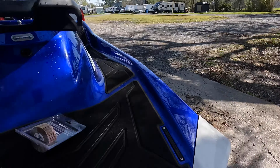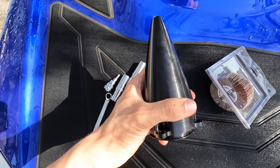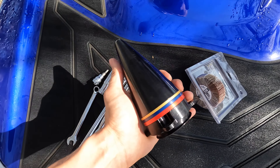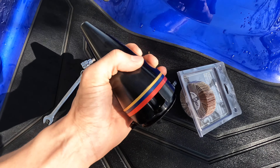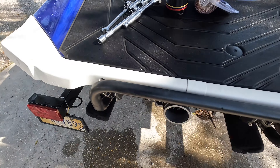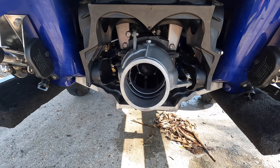That was 86 miles an hour at over 8,300 RPMs — higher RPMs than what I wanted. We're definitely going to get some speed increase with this pump cone and a little bit of an RPM loss, which in this case is a good thing. This is our Lucky 13 pump cone — it is adjustable. We've got three different spacers in here; I'm going to install this with the red and the gold spacer for now, that way he's got some spacers to take out in the heat of summer to get the RPMs back up, and spacers to add in when it gets cooler. We've got to take the pump apart — I've got all the tools with me to do that here.